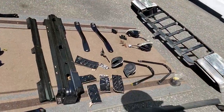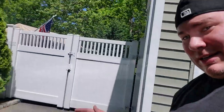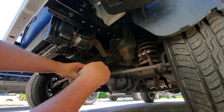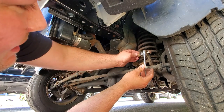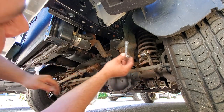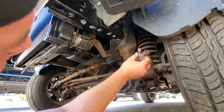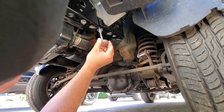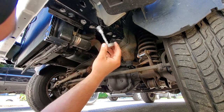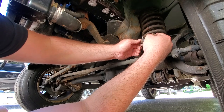You can see all my parts laid out nice and neat — 415 ready to go, beautiful header panel. Before I start putting anything back together, I'm just going to run all the threads I can see with some anti-seize — the sway bar mounts up here and everything that has a thread. First thing I'm going to install is the sway bar end links.